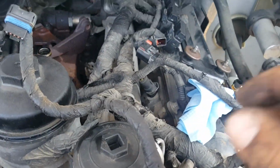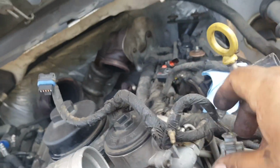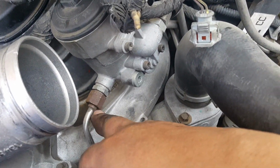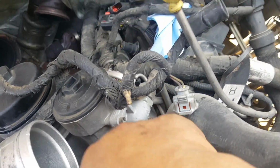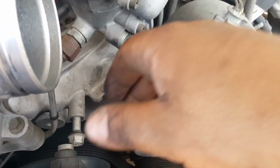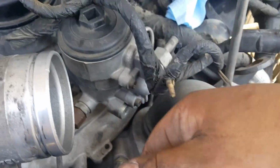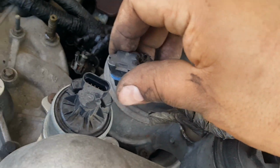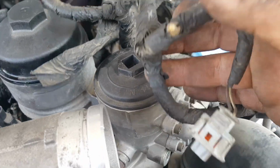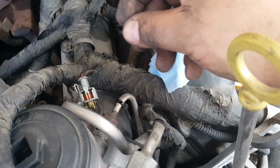Document how the wire loom was. For example, these 2 wires right here were actually through the bottom of this here fuel line. This one would actually go to where the thermostat's at, I guess, and the bigger one obviously went down to the fan connector, and this one went there. But just remember, these actually were looped through the bottom. There's another cable up over here with the same type of lock where you have to actually kind of pry it open from there.